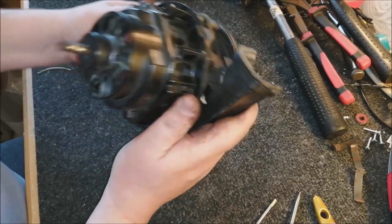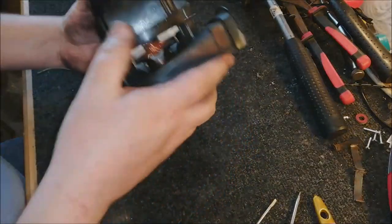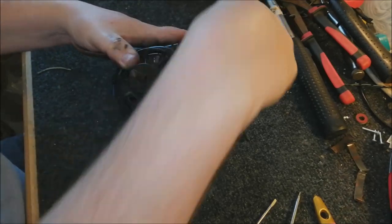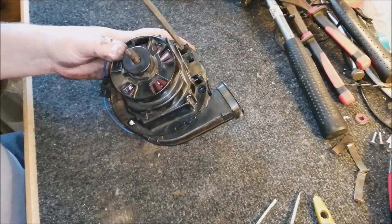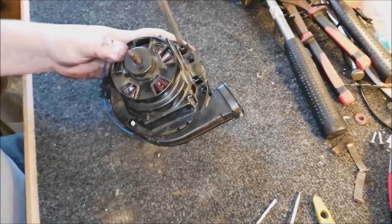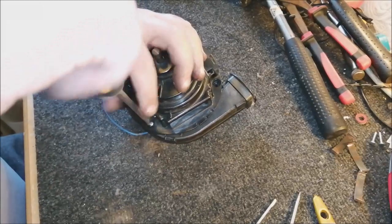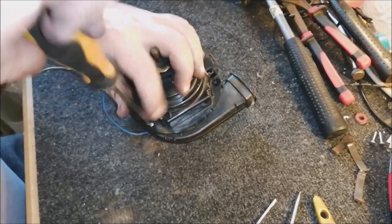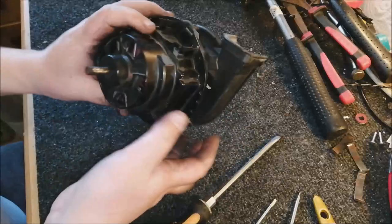Yeah, we expect that scraping because the field coil is not held in place. Now we put the four screws back in. We have to do this in a specific order. So you do diagonals first. You do this one and this one. So put these in first. It's very important at this point to give the motor a spin